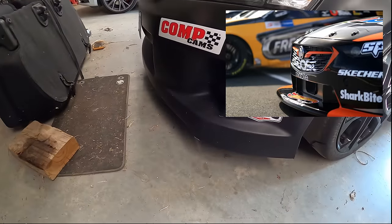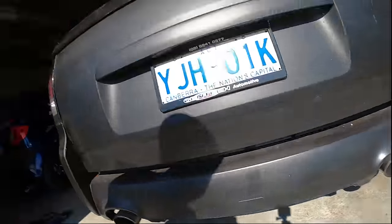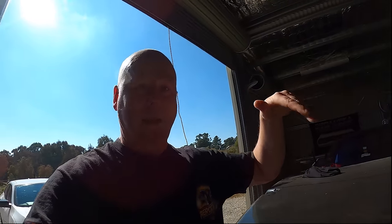When it comes to aerodynamics on a VE/VF platform, look at the V8 supercars. Get yourself a big decent front splitter — it'll obviously get down the front here and actually get some aerodynamics on the front. On the rear, get like a V8 supercar rear spoiler if this is what you're into, and then obviously invest in a rear diffuser. This is all about dispelling all the dirt at the back of the car, maximising aerodynamics at the front of the car and getting reduced drag. The actual downforce we're talking about is so you can actually get grip — more pressure onto the tyre and grip into the corners and help your braking. If you're driving your car around the street, you don't need any of those things. If anything, it's going to be a bit of police bait, and it's just seriously not functional.